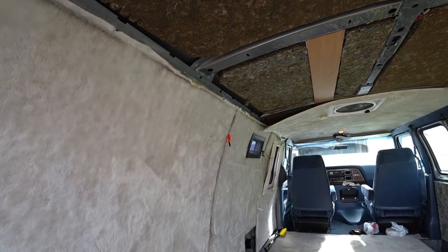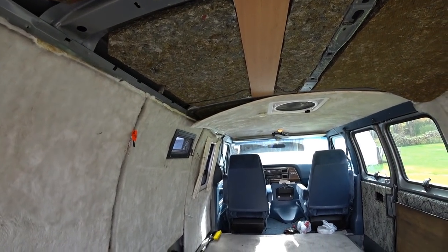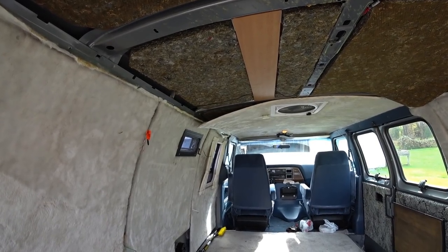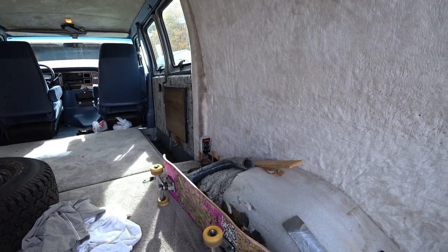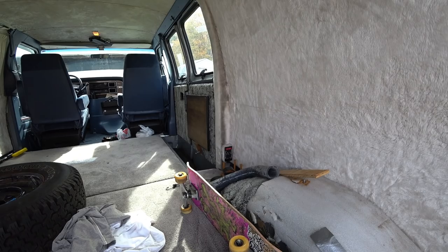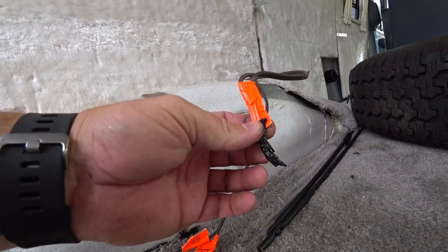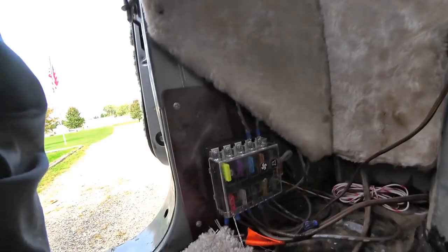There's a positive wire about halfway through on the RV — we just call that the wall positive because there's no negative to it. And then up there behind the driver's head, we call it the driver's roof — there's a positive wire there. These are pretty good gauge wires; I'd assume they can handle at least 2 amps, maybe even closer to 5 amps. This one we could double up and get a little bit more out of it since it's the same thickness gauge — put the two positives together for more current. And over here we have a positive and negative — this is just one big positive split into two wires. Everything's fused up.